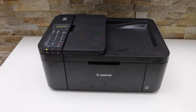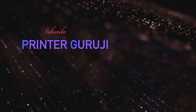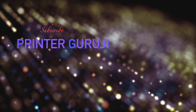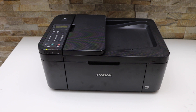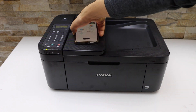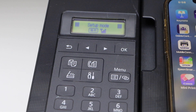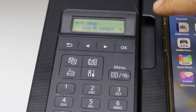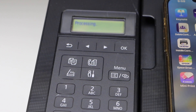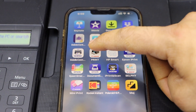In this video I'm going to show you how to do the Wi-Fi Direct setup of your Canon PIXMA TR4700 series printer using the inbuilt Wi-Fi of the printer. The first step is to go to the printer display panel. On the display panel, click on the settings icon, click Wi-Fi setup, then Easy Wireless Connect, and follow the instructions on your smartphone.